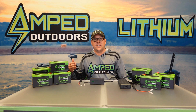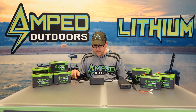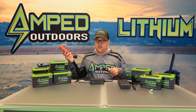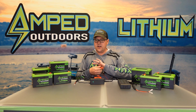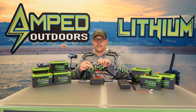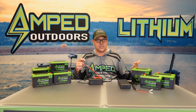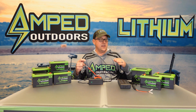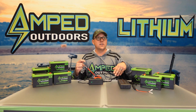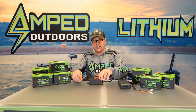Once the light is green, the next step is to make sure you have good power coming out of the charger. Take your voltmeter, select DC, and test at the connector that goes directly to the battery — positive to positive, negative to negative. A 14.6 volt charger should read right around 14.6 volts; in my case here I'm at 14.57. If connected to the NMC 16.8 volt charger it should be right around 16.8 volts. If you're getting proper output there, we're in good shape.